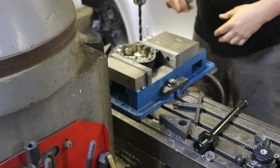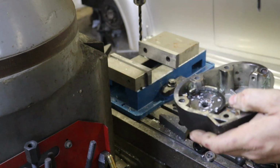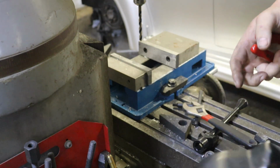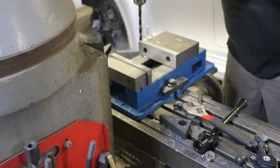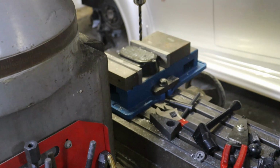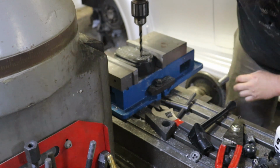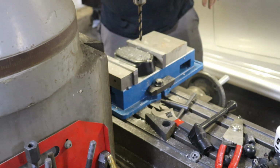we got our locating hole drilled. So now that we've got that done, we're going to pull out all our stock clutch mechanism here, which is a snap ring and our ramp and our balls. So get rid of all that. We're not going to need that anymore. And we're going to put our cover back, and reline up our hole using our same drill bit. And then we'll lock our cable back. Go ahead and pull that bit out.